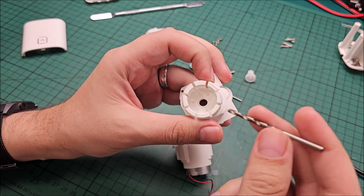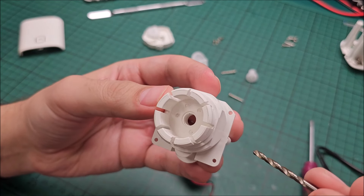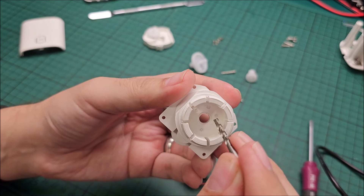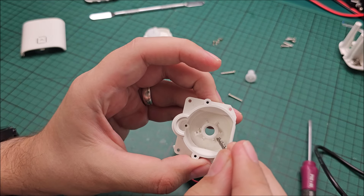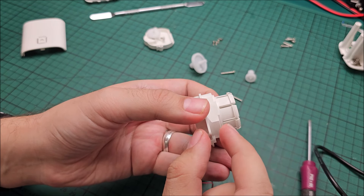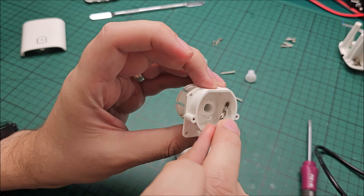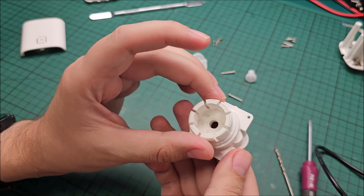What I'm going to do now might seem a little bit dumb and it probably actually is. The initial super glue has dried but this is not enough to hold this together — it will break again. Now I want to drill some holes in a few areas from one side to the other, then put some two-component glue on this side, allow it to go through the holes, and on the other side also put glue which will bond through the holes with the one on this side. So the glue will hold from both sides and also from the pillars, not allowing this to rip in this direction. I'll also drill two holes in this area and make sure the glue goes through those holes so it grips and won't allow it to rip out.